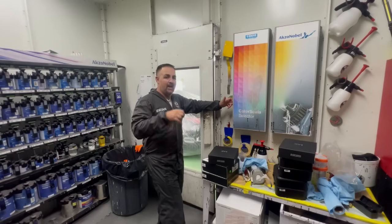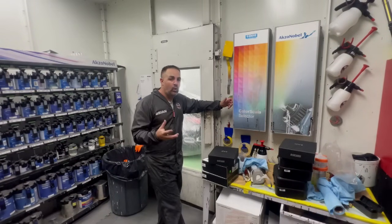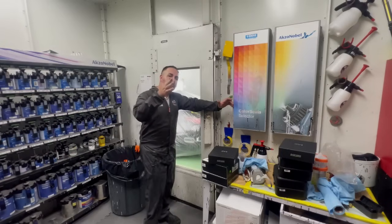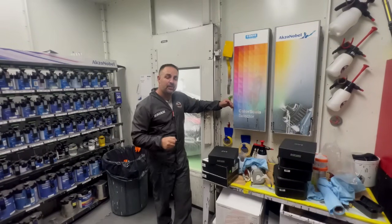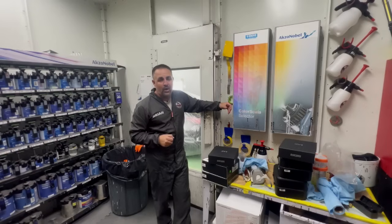Remember how we cleaned the car completely before it entered the booth, and we wiped down all the panels, and we have that booth coating. So between the pigment and the particle control, everything adds up. The neutralizer, all those little things, the spraying of the wet base coat. These are all little things that you can do and start applying on your next spray job to get similar jobs like this. Now we're only gonna take a few moments to go ahead and nib out where we need to be, and this car is on the road.